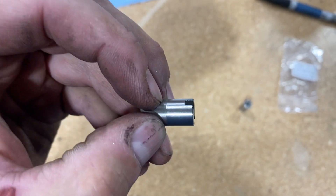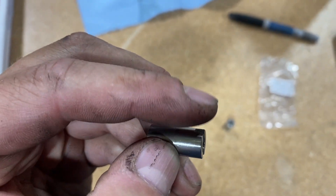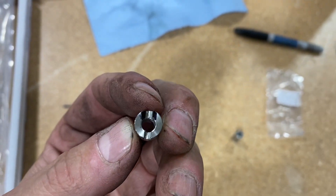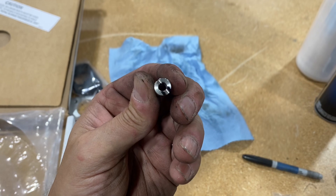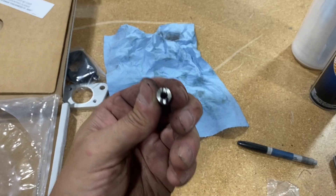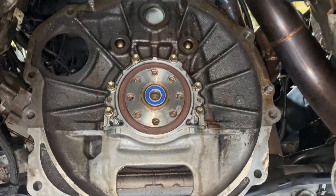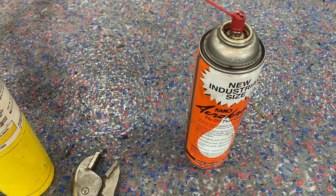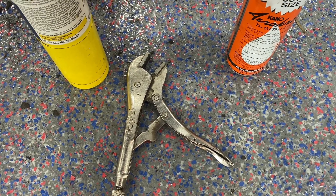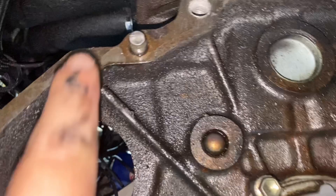You can see the slot and I have it marked. If I put my finger down here I can feel that ledge going upward, so the high side on the outside bell face is pointing this way. Since I'm straight up and down, the dowels are going to be spun so the bell moves downward toward the high to cut that high number roughly in half. For removal, I recommend three things: good penetrating oil — spray it on the dowels and let it sit overnight — vice grips to turn the dowels, and map gas if you can't get them to budge. Heat up the block material around the dowel to expand it and the dowel should pull out.